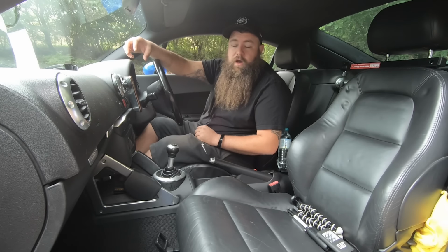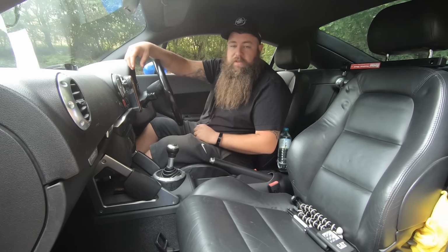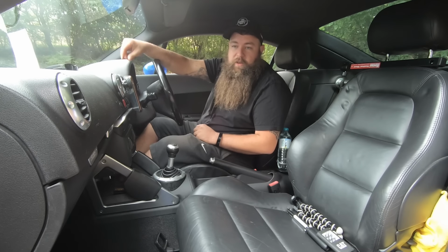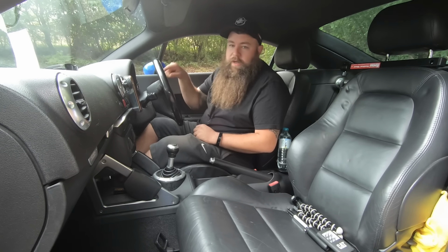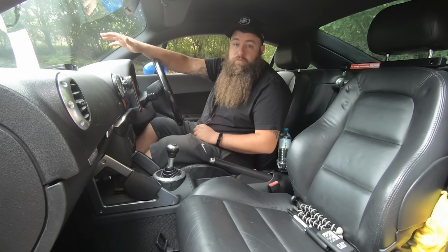They sit on the underside of the engine, just above the internal of the sump. What they do is draw oil up into the engine. Now they can get blocked with sludge, with bits of anything that's left in there, bits of the old pickup, the old pipes, the dipstick pipe if it drops and breaks and falls in there. That will cause you low oil pressure, which could starve the engine, and you'll get that horrible red oil can light on your dash, and you stop immediately because it could ruin your engine.